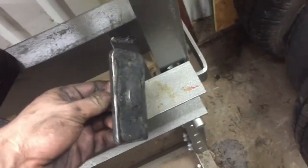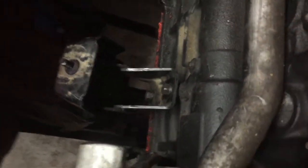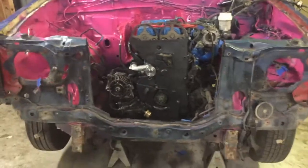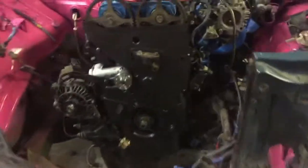To make it actually go in right I had to take this little plate off the engine mount. Basically it's just an extension, but there was no way the engine would fit with that plate on there. I wasn't able to figure out a way to keep it, so I'm just going to leave it like that. If I notice it shaking around then I'll figure out a way to put it back in. It's officially in for the last time, my firewall clearance is perfect. Now I just have to do piping, wiring harness, plumbing, and literally everything.